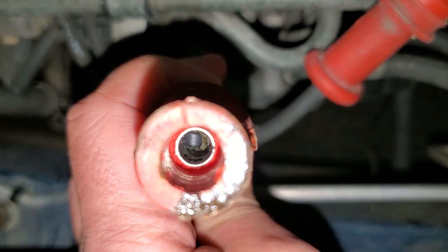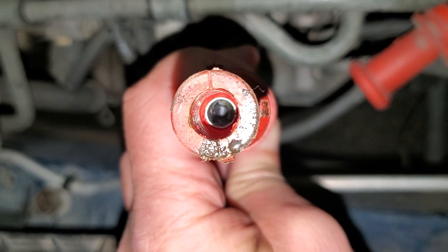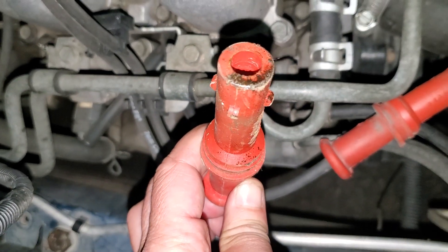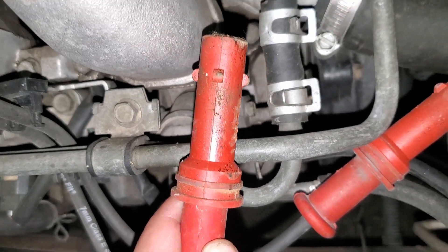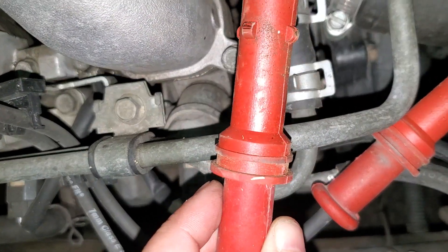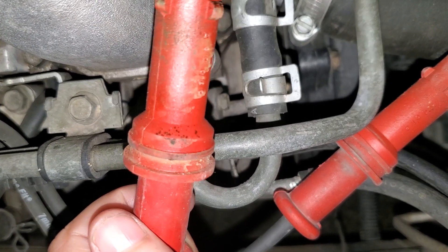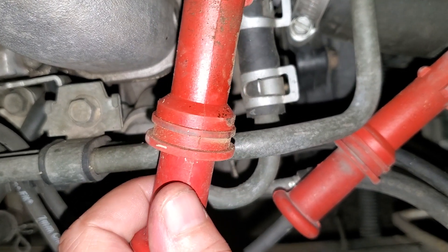This one — maybe a little bit more use — but then I see the oil at the end, and it kind of made contact with the spark plug. But that's oily from the inside. And it looks like that dry spot right there is actually where the gases were escaping around the seal.